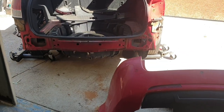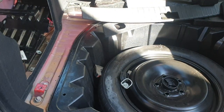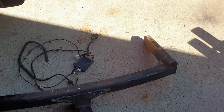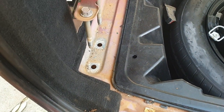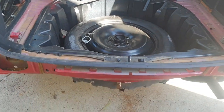Just a bit of a recap: if you're going to be fitting a tow bar, bumper bar off first. Then take the trim sections off in the boot area — trunk area, whatever you want to call it. Grab your tow bar assembly, put a bit of lube on each end — some CRC — sliding it into place. Once you've got your mounting bolts out of the way, tighten them up — they're all 15mm head so just a 15mm socket will be fine. And that'd be your tow bar fitted.